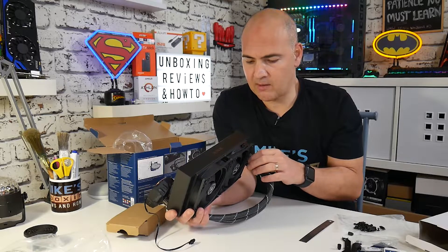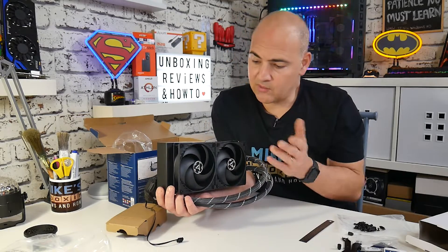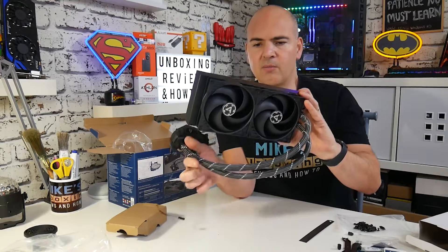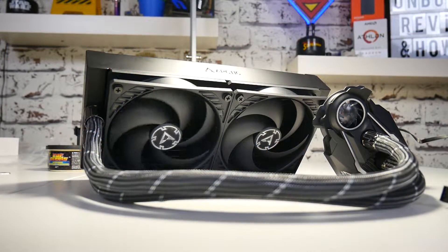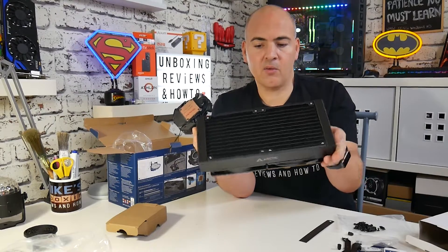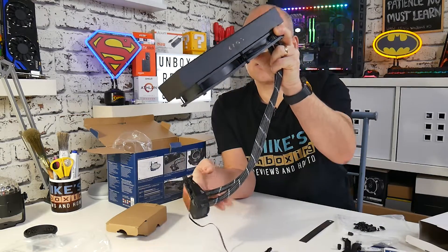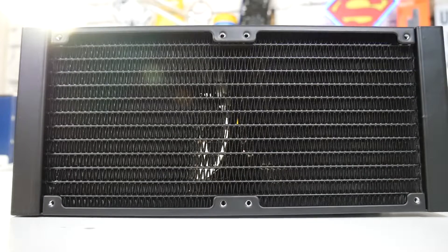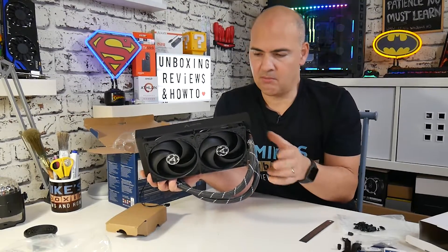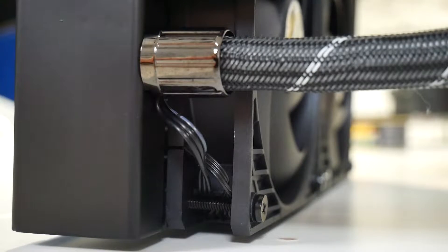Everything is pre-assembled out of the box — literally the fans are on and all in the right place. Now if you wanted to, you can actually remove the fans. This is set up ideally for exhausting, so if you're putting this into a PC, probably the best place would be either at the top of the case, pushing hot air through the fins and then out through the case. If you wanted to mount it another way, you could do it at the front of your PC. And if you want to, you can just take those fans off, unscrew them — the screw holes are there ready so you can turn the fans the other way, although you would then have a cable running around the side. It's actually a very tidy setup, with all the cables nicely routed around the inside of the fans. Looking from the other side, it looks completely bare — there's nothing there whatsoever, just the tubes coming down, which is going to make a very, very clean build.